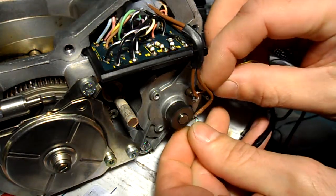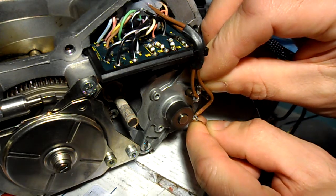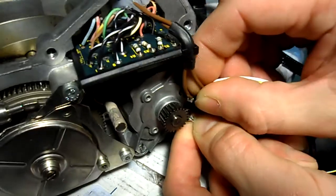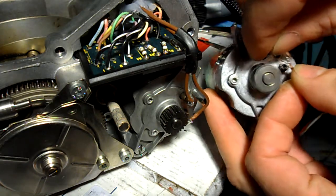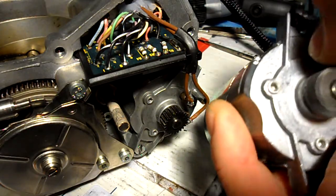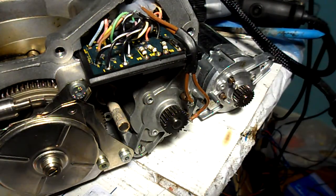This is the replacement motor I put in there already. This one spins good — it's faster. Notice the speed difference. I can shake it a little bit. I tested it before, but this one is just slowing down kind of. So this motor is not good. I'm going to put the gear back on and open and close the throttle body with the replacement motor. Here we go.